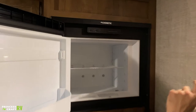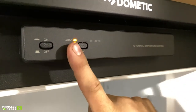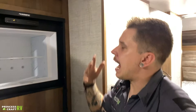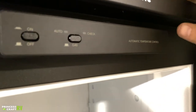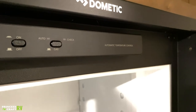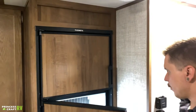Jumping over to your refrigerator — this one has the eyebrow board on the inside. On-off switch kicks it into auto mode, which prefers AC voltage. If it does not find AC voltage, it will automatically switch to gas. If you want to run it on gas — for going down the road or boondocking — depress that light. When running on gas, there is no indicator other than the switch position, unless it fails to light on gas, in which case this check light will illuminate.